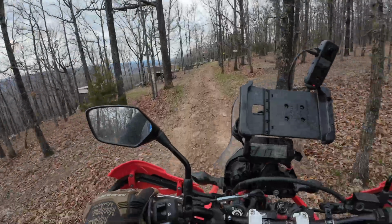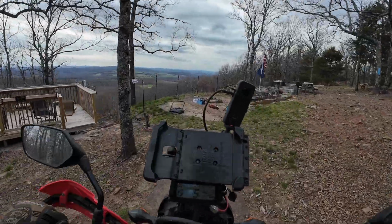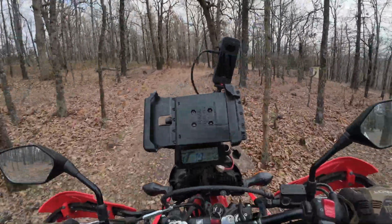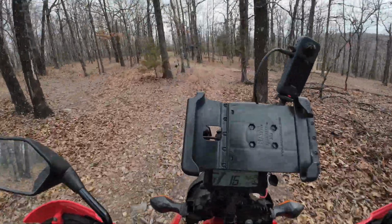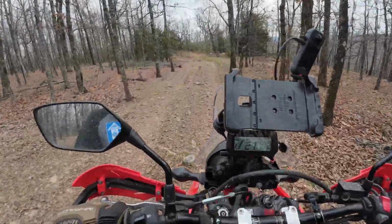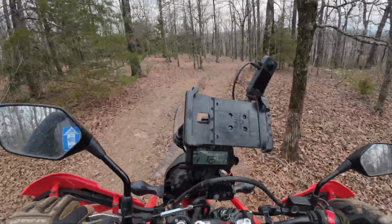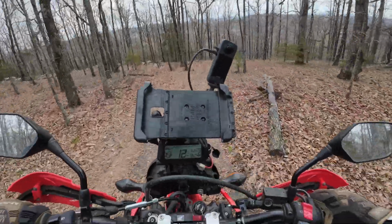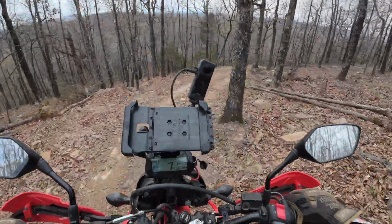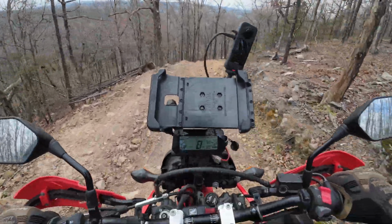As we're driving along here, I really hope that you can see where I'm coming from on keeping the tire pressures at 22 psi, or whatever the recommended tire pressure is for your motorcycle. I mean, the Rally is a fairly heavy bike, and I personally believe 15 pounds, at least in rocky terrain, is definitely not enough air, and I think the videos can show if you hit some rocky patches why I believe that's true. Of course, if you're riding something like a Beta or a KTM that's pretty much a race bike with blinkers, the 350s, 500s, those things, you probably bring those down quite a bit and still have about the same safety margin as what I have at 22 psi on this Rally.